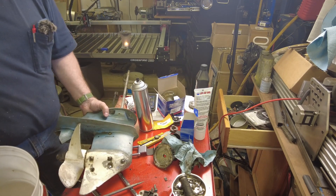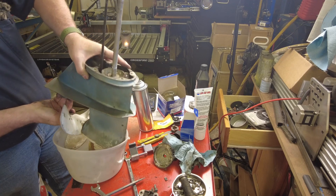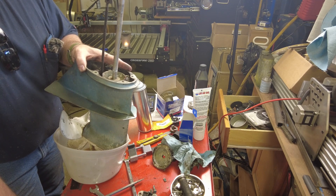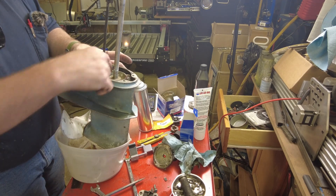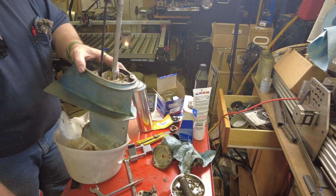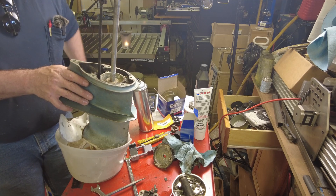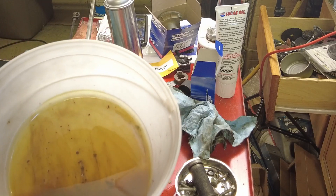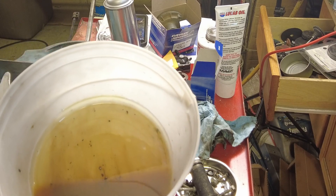We'll grab a bucket — now that I've pulled the drain plug and vent plug out, we have a little more water in there. Considering I drained all the water out and put fresh gear oil in, the fact that we ended up with more water pretty much confirms to me that the seals are shot — either the seal at the top or the seal on the propeller side. We didn't run it very hard in the tank, just got it to fire, and that was enough to get more water into the lower unit. Those swirls of what looks like gravy are water mixed in with the oil.